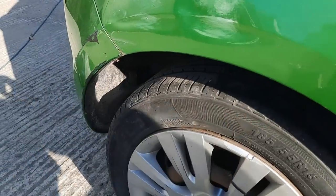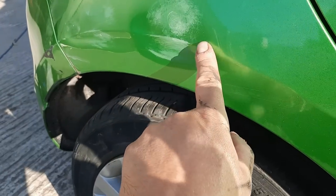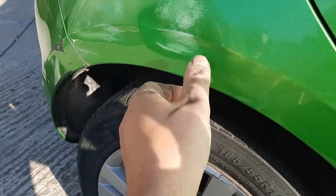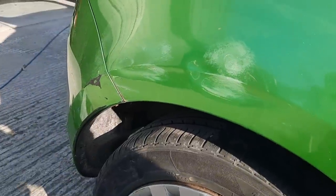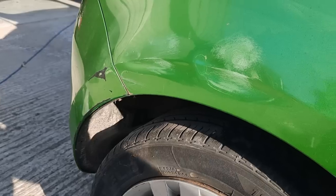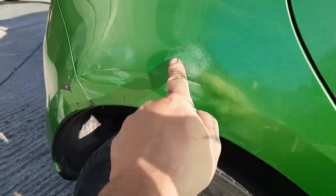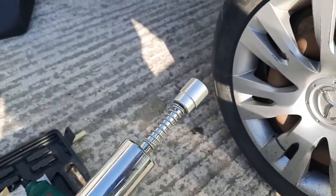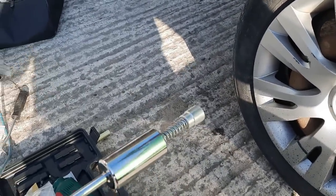These were quite heavy dents. It won't work on something too tight - if you've got a swage line and a very short area there isn't a lot for it to pull on. There may be guys with more experience and better kit who can manage it, but dents on a wider panel you can pull with these slide hammers. They're not expensive - you can get cheap setups on eBay.